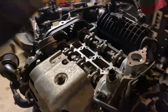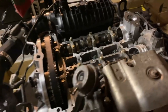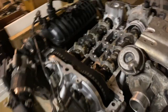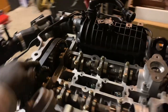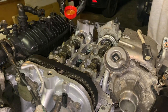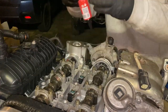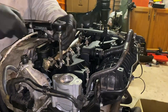The one more thing I want to do before fitting the rocker cover is put a bit of engine oil on the cams to lubricate them — I did use assembly lube earlier but it's been a while. I'll also rotate the engine over a couple of times. I've got the right oil for this car including the wet belt spec. I'm pouring a couple of capfuls down the full length of each camshaft covering all the lobes and bearing caps, then cleaning all mating surfaces, fitting the new gasket, applying sealant to the spots recommended in the Haynes manual, lifting the cam cover into place, hand tightening all bolts, torquing them down, and reinstalling the fuel rail.